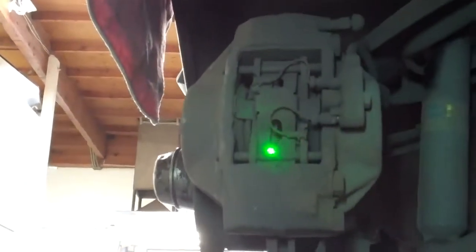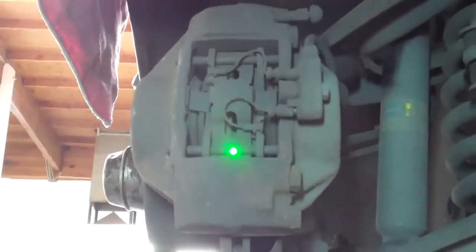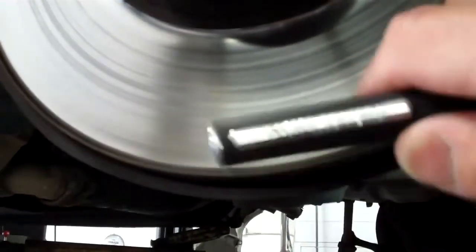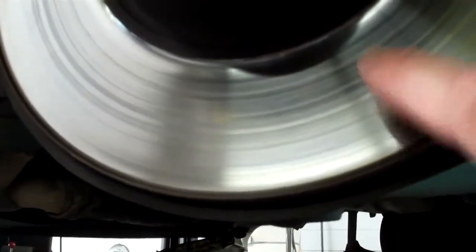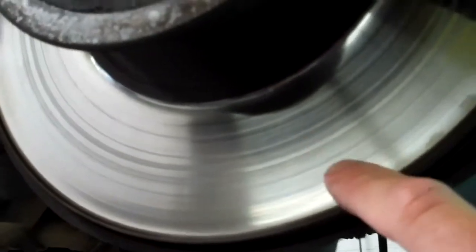The next thing I'm going to show you is that the brakes are really low in the front — they're almost finished. This is the brake pad wear plate, and when the brake pads touch the wear plate it's an indication that the brake pads are finished. We're going to recommend that you do the front brake pads. In addition to the pads being low, you're also going to need the brake rotors — they have a sharp edge on them indicating significant wear. The minimum spec requirement for these rotors has been exceeded, so you need to replace the front brake discs and pads.